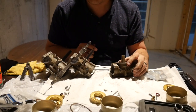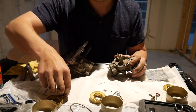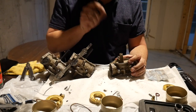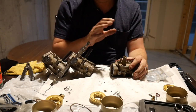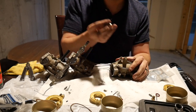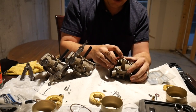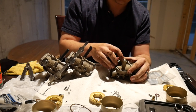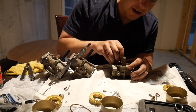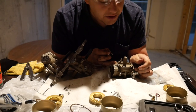A trick I just figured out, in case you're doing this on your own: once you get the old crappy one out and take out this little clip, put the new little rubber piece in there, make sure it's flat and lined up, put the clip back on top, and use the old needle to equally press that clip down into the hole. Once you get it to the very bottom, you'll actually feel the springiness of the needle making contact with that rubber — and that's how you know it's down there all the way.